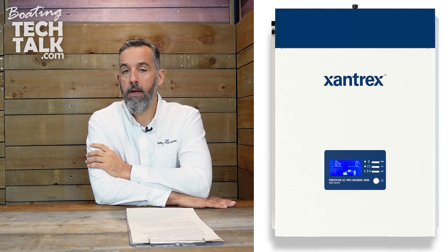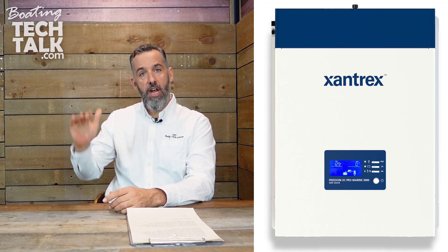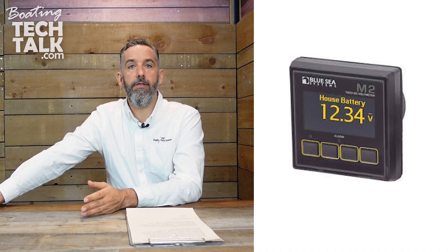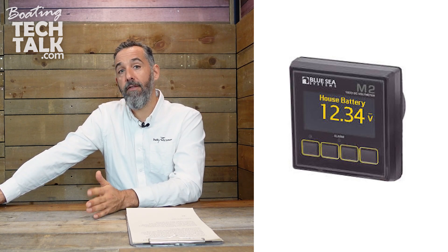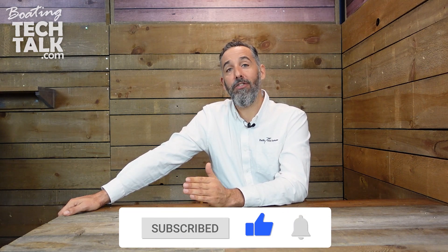Now relating to the charger: the charger is not something you have to test away from shore power, because being on shore power gives you the advantage of having your charger running. Every time you plug in or unplug from shore power, you should see the effect of the charger's charging voltage change on the battery. It doesn't matter what the battery voltage is — 12.8, 12.6, 12.4, 12.2, even 11.5 — the moment you plug into shore power, that number should go up. You want to see a reaction to your action. Making sure shore power is powering your battery charger, which in turn keeps batteries topped off, is very important.